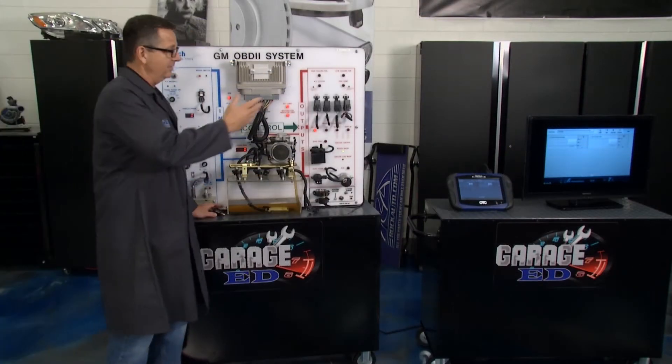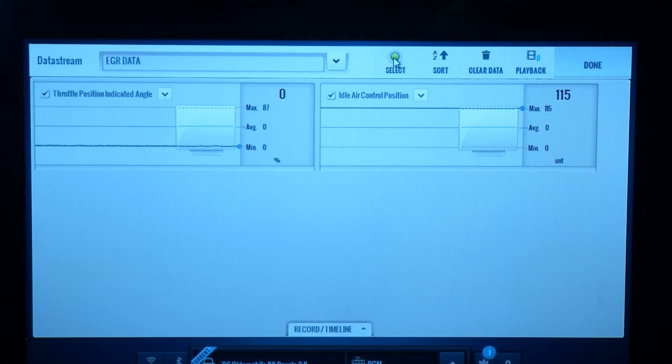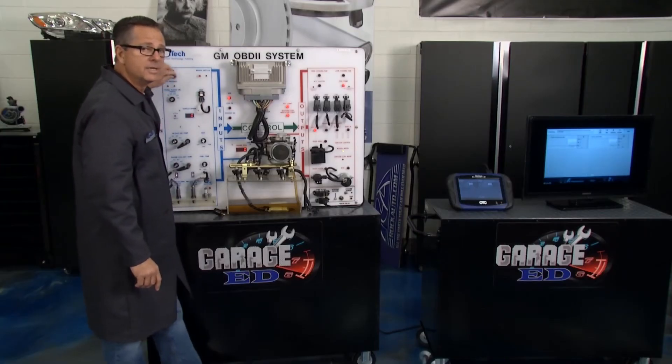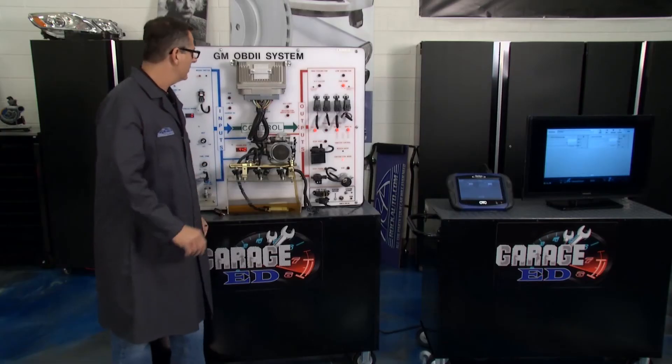In true Tech Garage fashion, let's see it in action. On the left side of the screen you see the throttle, and on the right side is the idle air control — it's at 115 counts right now. When I start up the car you can see it change: the throttle stays the same, it went up, now it's running back getting the idle under control at about 82 counts. If I give it gas, watch it come up again — then I slam off the throttle and it grabs the idle and gets it under control.